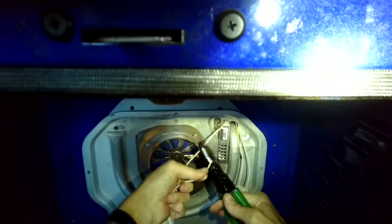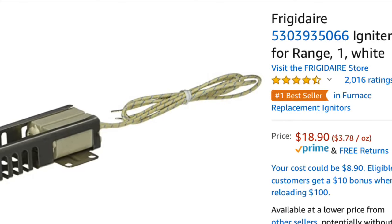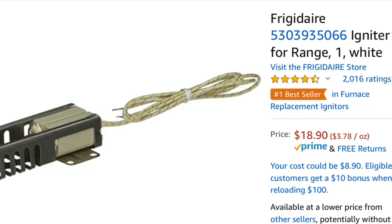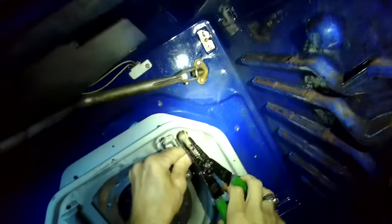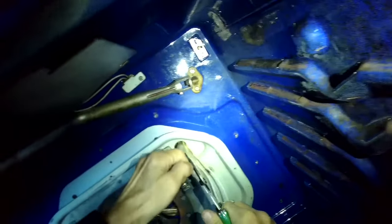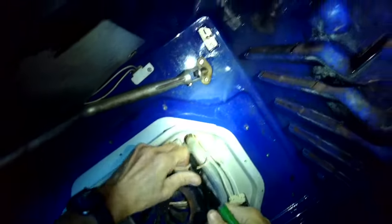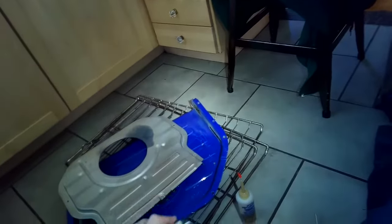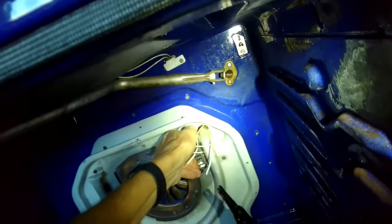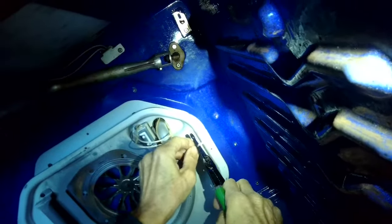We're cutting those wires and going to strip them back by about a quarter inch. Here's the igniter that we use — pretty cheap, get these from Amazon, and again I'll put a link in the description below. We're cutting the wire and stripping it back about a quarter inch, then we're going to take our porcelain wire nuts and use them to connect the wire from the oven to the wire from the igniter. When you connect them, you just want to put the two wires into the wire nut and then turn it righty-tighty until it's turned as far as it'll go — you feel like it's a really tight connection. Then we'll do the same thing with the next set of wires, one from the oven and one from the igniter.